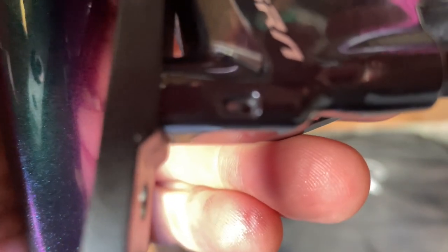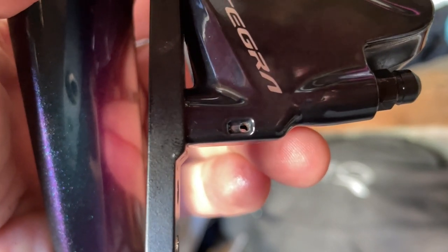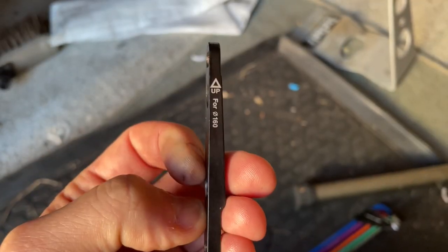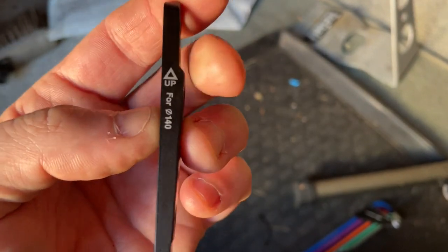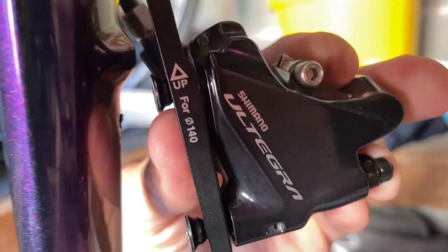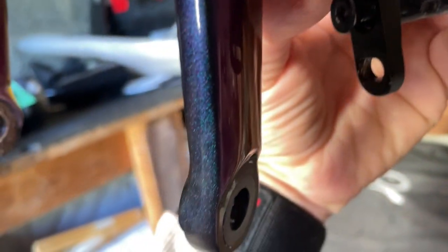When you're undoing them be careful — there may be a little pin in that hole in the middle of the screen to stop the bolt coming out. Be wary of that. I've got the shim off — it's marked up for 160mm. You just flip it over and it's up for 140mm. So the shim goes back on with 140mm up and just tighten up those bolts and then attach everything back onto the fork.